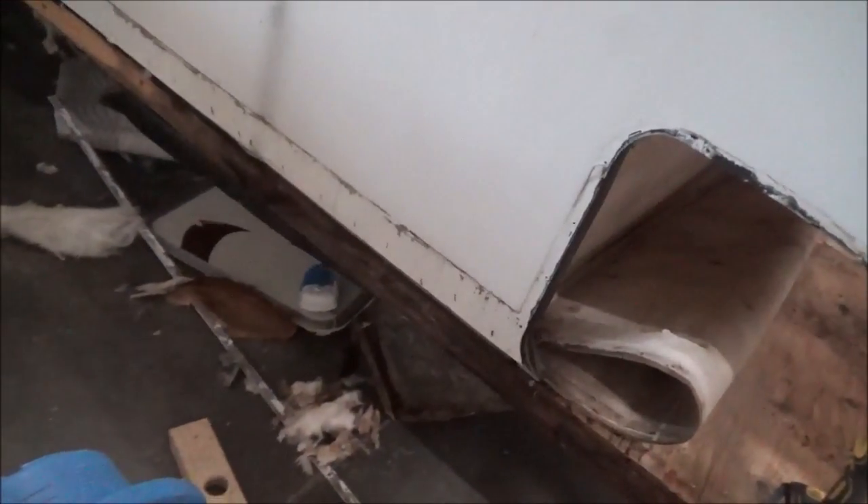We want to see how much we've got to do for repairs. We started going all the way down here — we've got these blowers on here because all that insulation underneath was pretty wet. You can see that rot goes all the way down here — probably about six or seven feet of it right there. We'll sit the blowers on it and investigate it afterwards to see if it'll still be solid good wood or if it's actually rot.